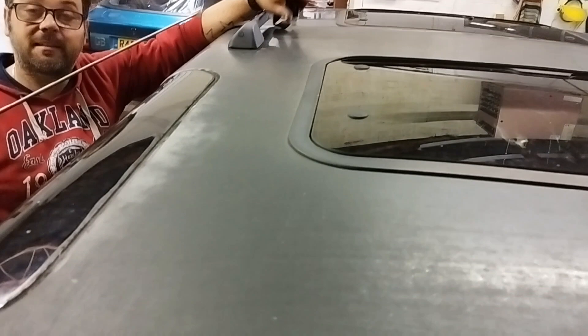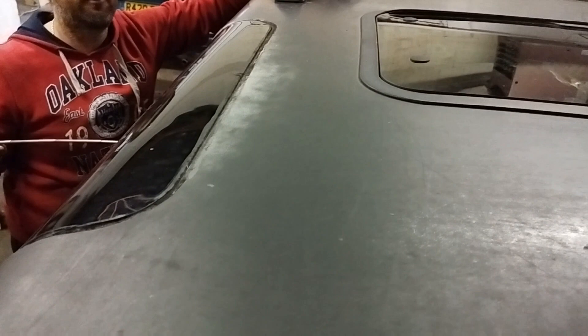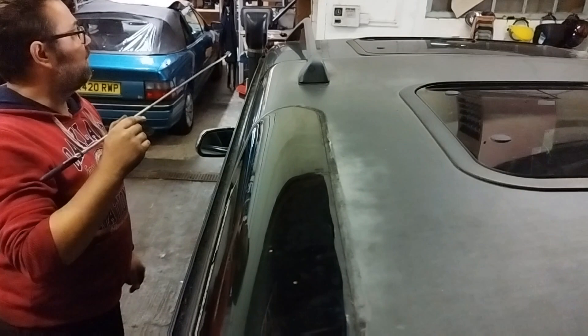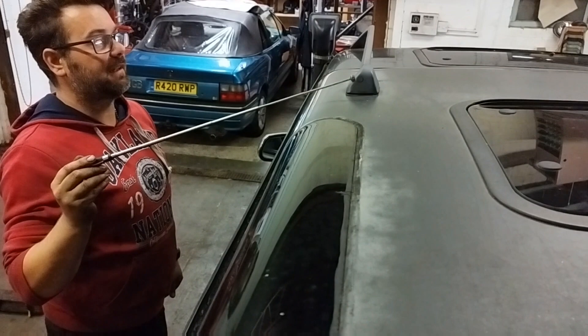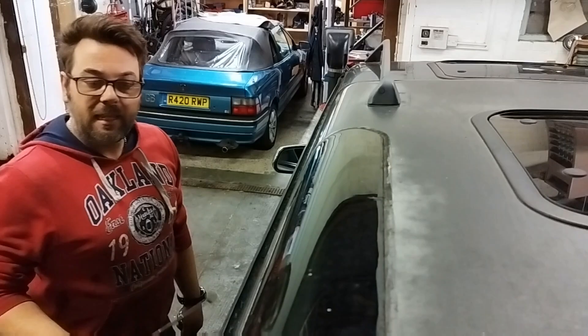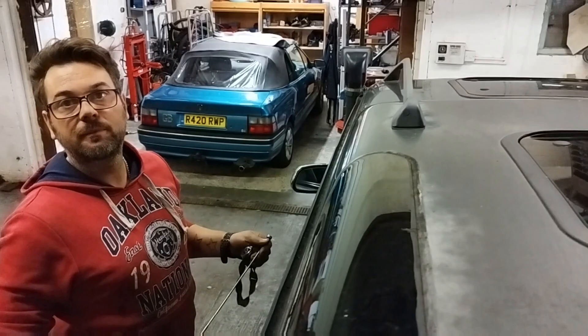Have a look around and see if you can see any signs of water. Check if these have been sealed, as they can leak too. Basically everything leaks on these. In the gutters, have a look inside because they have a tendency to gather rust and start to rot on the spot welds. This one's been cleaned out and repainted. Also check around the front window and the guttering — we've experienced leaks coming through the joint where it's spot welded on.